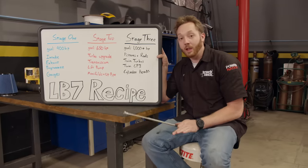Remember, this was a long bed Duramax pickup that we converted to a short bed — something that GM never produced. We cut 14 inches out of the frame to make it happen. We could have taken a Duramax diesel engine and swapped it into a short bed truck without cutting a thing, but then we wouldn't have gotten the thicker frame, the big three-quarter ton rear axle, the heavier suspension, the eight-lug bolt pattern, and heavier brakes. To do this conversion, we didn't need a single aftermarket part — even the fuel tank pulled from a short bed pickup fits perfectly in the frame rails. We went through a handful of junkyards trying to find a short bed for our truck, and most were pretty smashed. This is the best of two that we found, and it's got quite a few dents in it, and the way they stored this thing at the yard, they bent all four corners.